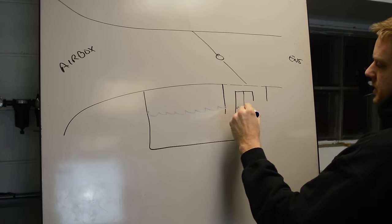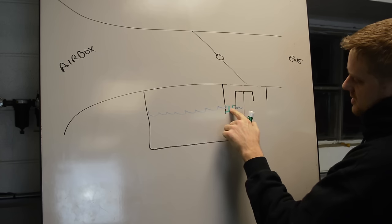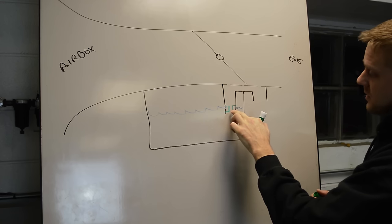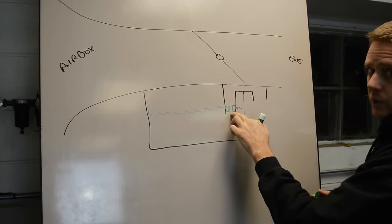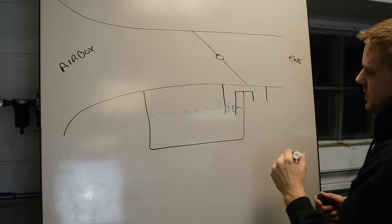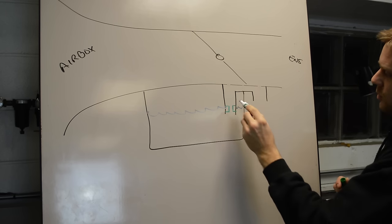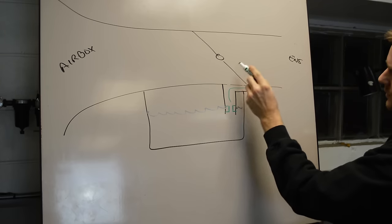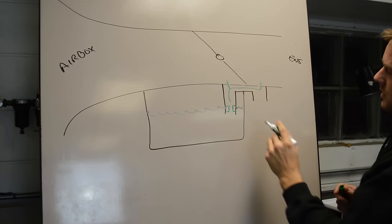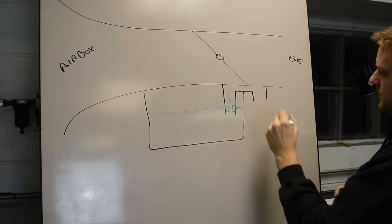All right, so we have some fuel in here, and here is our Pilot jet. Okay, so here's an orifice, and the larger the number on the Pilot jet, the larger this hole will be. Okay, so this is your metering for this circuit. Okay, so fuel can come out two ways. It goes here in front of the butterfly, and it also goes here right behind it. Okay, and I'll explain what both of these do in a second here.